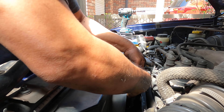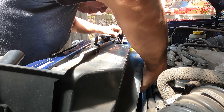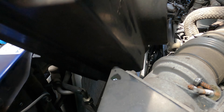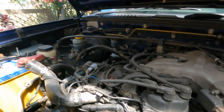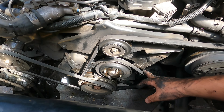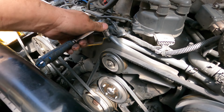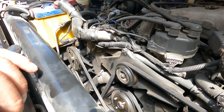For Nissan, the engine is all right, but when it comes to maintenance and service for a big job like this, it's a real pain because they have no room at all - especially Nissan Xtera and all that. That's why back in the day when you talked about Nissan to me, I was really scared. So we got them released - all the tensioners out, all the belts out. Remember, all the belts need to go back later - which one goes where. The big one, medium one, small one. Now take it off with number 14.